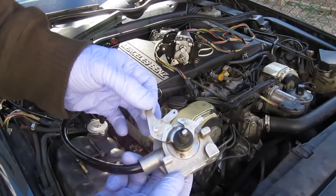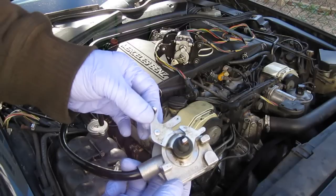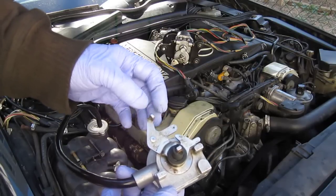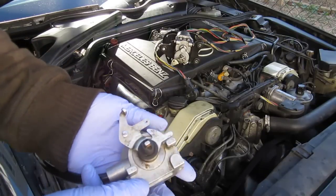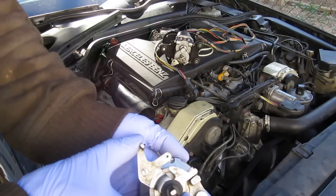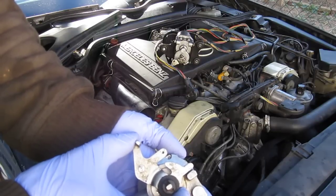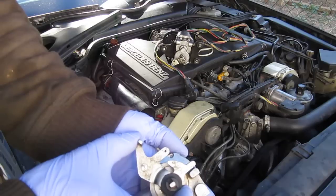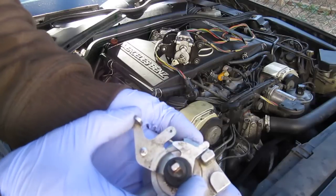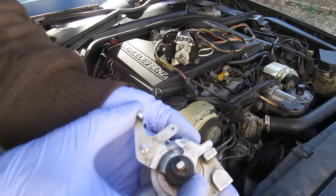It does react nicely. Once it hits that micro switch contact, it drops to idle. Gotta wait for the car to warm up a little bit so it will stop shaking. But this is idle right now. As you can see, there is no movement of the actuator at this position — the micro switch is working good. The second I go past this, it activates the actuator. As you can see, nice and slow. The second I hit that micro switch, no movement, no response from the actuator — which is a very tiny little point here. No response because the idle contact switch is actually open.